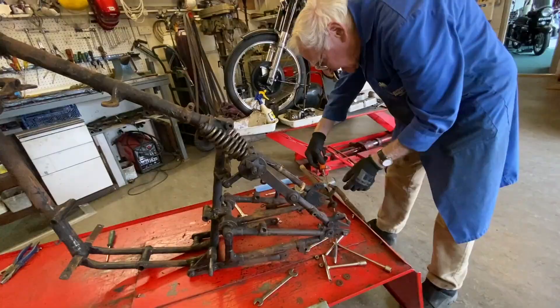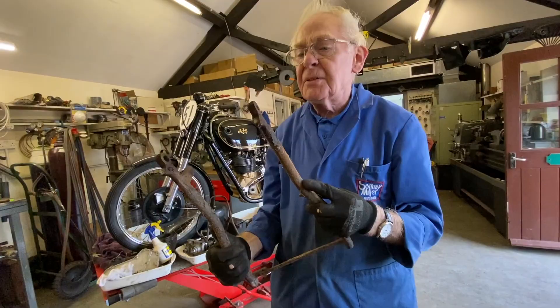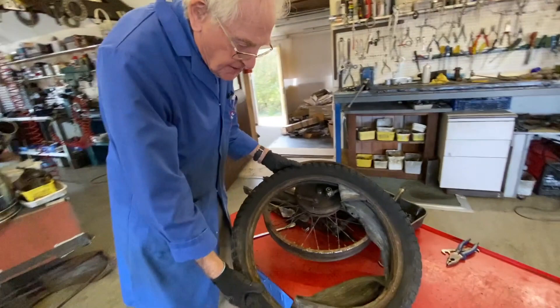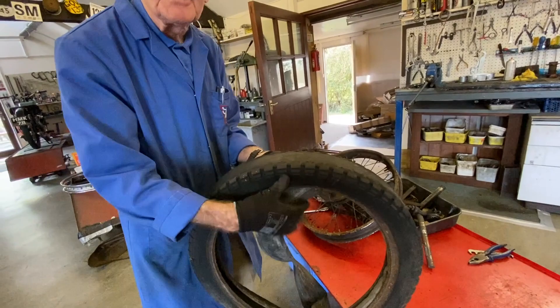Now we've got the front end out. Just taking the rear stand off — as you see it's pretty badly eaten through here and a bit skew-whiff, so there's a serious bit of work to do on that. Taking the tyre off — what I do is cut them off because it's a lot easier. The tyre's scrap so I just get a disc cutter, take it away from the rim, cut it off — bang, off. Saves a lot of time, a lot of effort, and flying skin generally. So that's the way to get your tyres off.